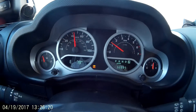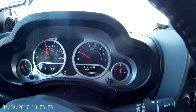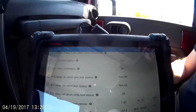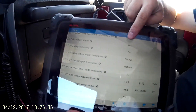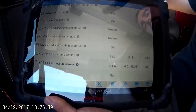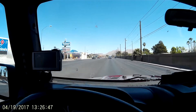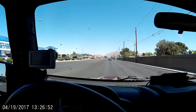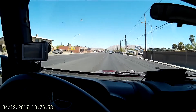I personally prefer automatic — I think the 6L80 does an excellent job, and it is adaptive, meaning it learns how you drive. Our air conditioning right now is doing a lot of different things. You can see our AC request signal right through the GM side, as well as the AC pressure and the command on the air compressor. The GM side is getting a signal stating that AC is requested on.